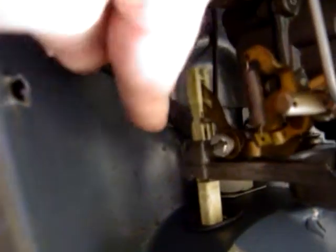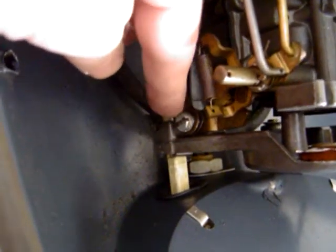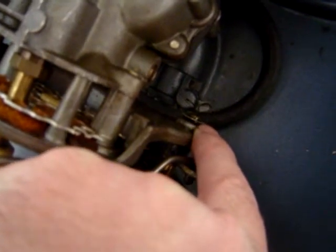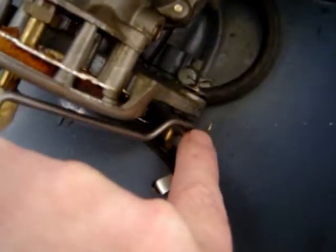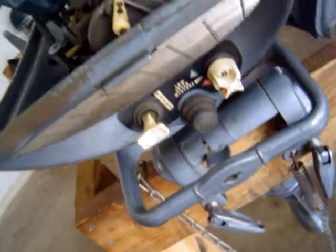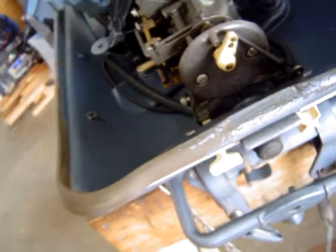In addition, removing this little screw at the bottom here that's holding the choke knob — once you remove this, you can easily remove the choke knob and slide it out. Down at the bottom there is a little e-retaining clip that holds this little linkage in place. If that little e-clip comes out along with the little wave washer, you can slide the adjustment knob out and then unbolt and remove the carb from the bottom to work on. So that's not really that hard.